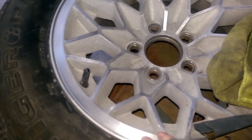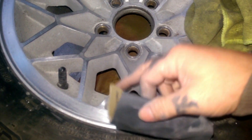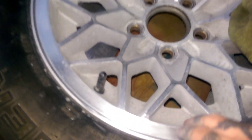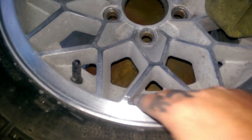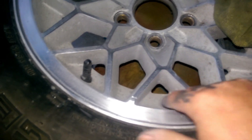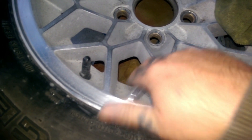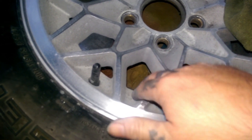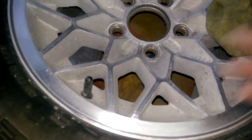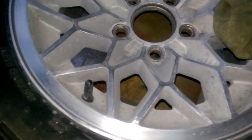We've done the 400 step to this and went over it with 600. We are now on 800, going around just the top part here with 800. Once we get that, we are going to use a scuffing pad or sandpaper — it just depends on what you prefer, but a scuffing pad gets in here better — and scuff the insides of these. They're kind of a hard casting, so you need to scrub them pretty good. Now they will have some dark places; you ain't going to get that off no matter how much cleaning you do to it, so just scuff them the best you can.